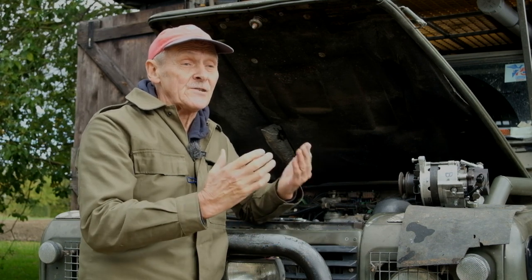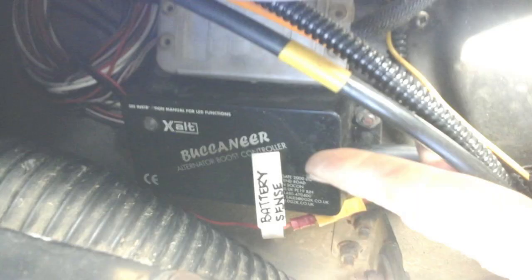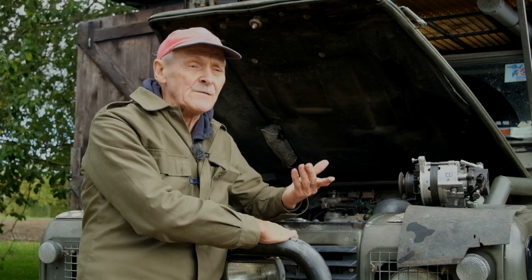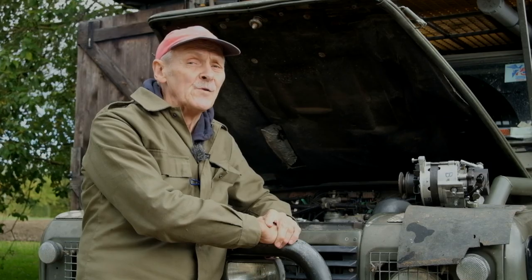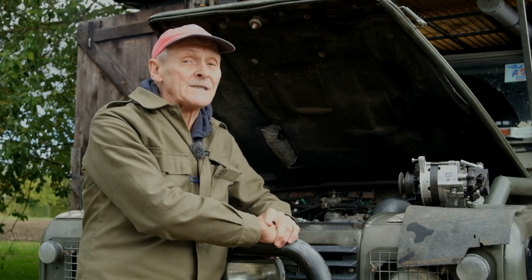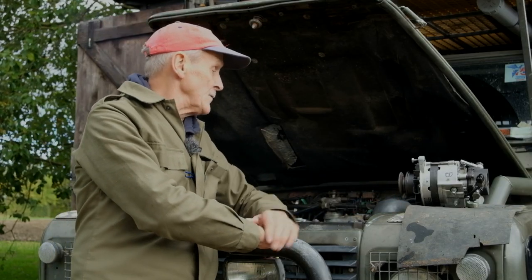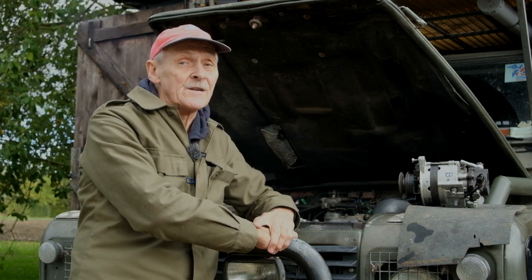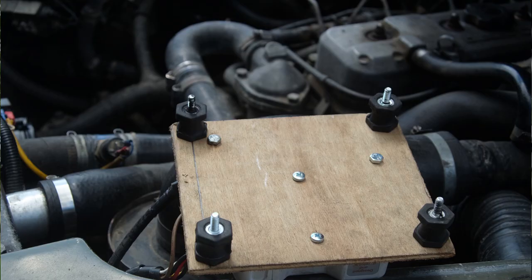I've broken my own rule by introducing electronics, and I have a smart charge controller. For a number of years I used a Driftgate unit made by a small firm in Cambridge — very popular in the marine world — but they went out of business a few years ago, so the unit was no longer supported. This was too much of a risk, so I relegated the Driftgate to the spare and bought a more modern Sterling Pro-Reg smart charge controller instead. The two units are mounted side by side on a backing plate, which goes high up underneath the wing. It's close to the alternator, stays very cool, and is high enough that it doesn't get flooded even during deep wading. Electronics don't like vibration, so the backing plate has rubber mountings.